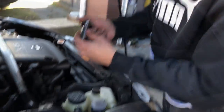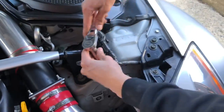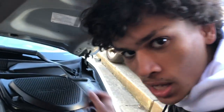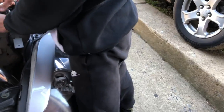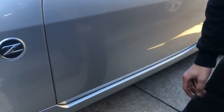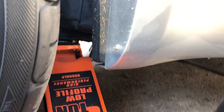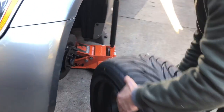The first thing to install the front coilovers, we're gonna be removing this bar right here. We just jacked it up on that side and we're about to jack it up on this side. I had to reach in and grab it from right here, so I can actually put the jack stand right here where it's supposed to go. We jacked up the car, got everything ready, and we just took the wheels off.